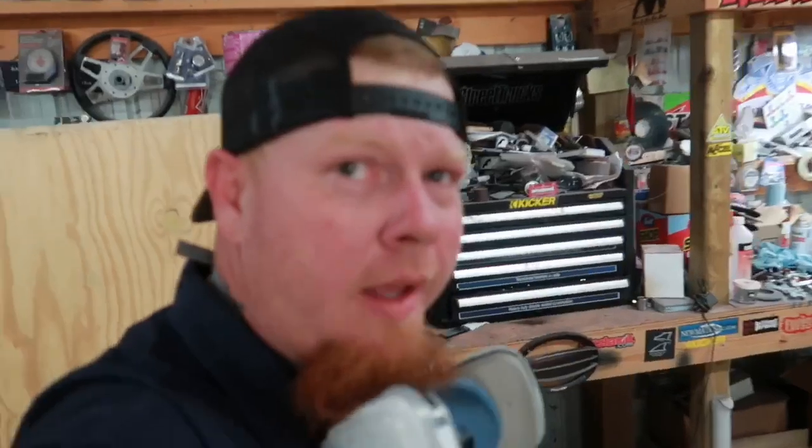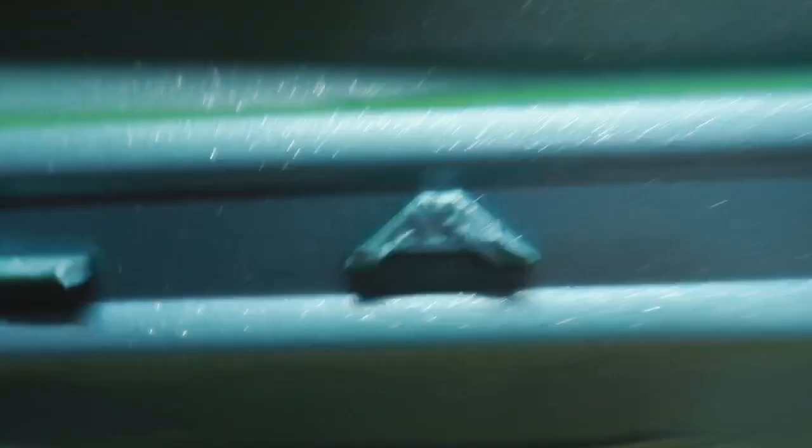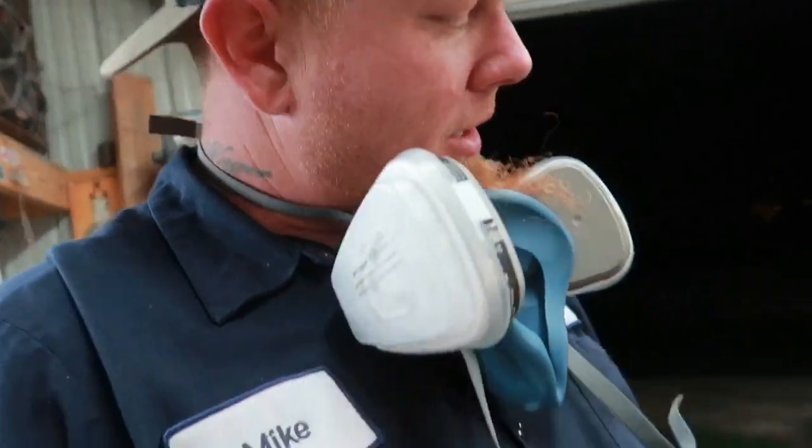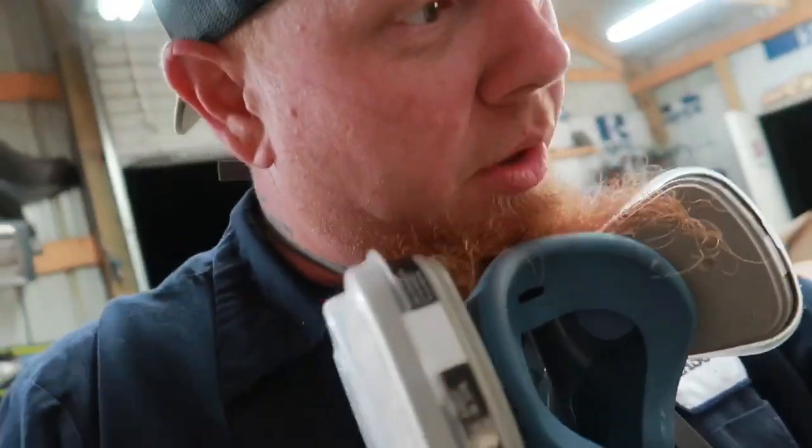Got one mist coat of flake on it but I don't think it's going to be enough — probably put another coat on or heavy the flake up a little bit. You can see it glistening there, it needs a little bit more. A little bit more flake is going to help it out tremendously. Went ahead and sprayed a second coat of flake — I think it's going to be just enough. Once I put that candy through there in the sunlight, it's almost like the size of a big pinstripe but gets real thin in the front. Take a look.